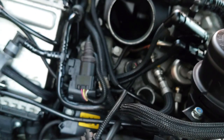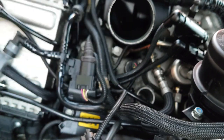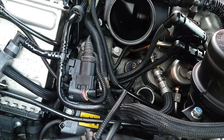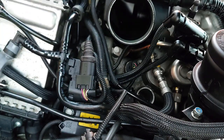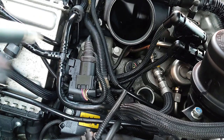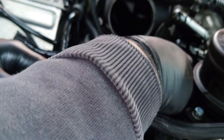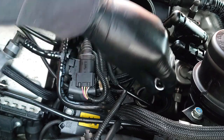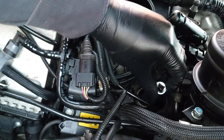You need a tool with the right fitting, because they're different plug splines. It's not like a hex spline, you can see that it's got a special shape. And this is magnetic, so once you put your plug in, it's got a little magnetic seat, so when you've got it upside down like that, the plug won't fall out. It's a nice long reach, so you can actually get down to the bore, find a nice seat for it. Going in.